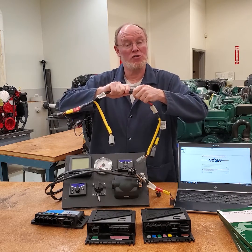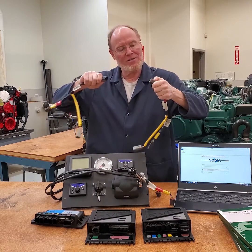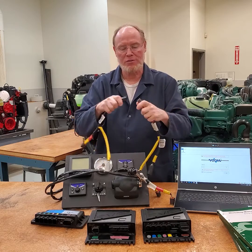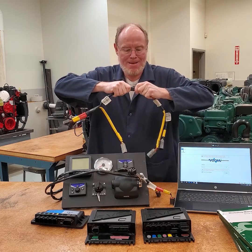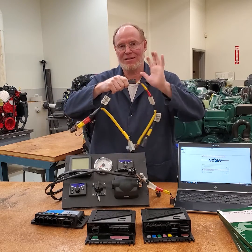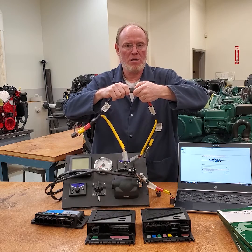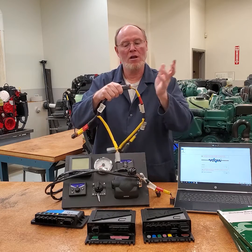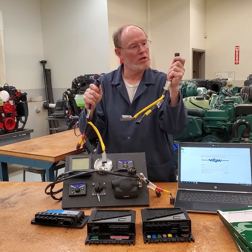If you don't hear that click, you don't have a good connection. A lot of times under the dash, people are trying to get up in there and it's hard to get those to connect. You absolutely have to make sure they're fully connected. Any time you're doing an inspection, what I always do first is reach up and grab the connectors in my hand and give them a little pull — the wiggle test. The wiggle test is not grab the wire and wiggle it; it's grab the connectors and lightly pull on them to see if they come apart. If they do, you've probably found the problem.